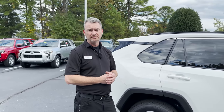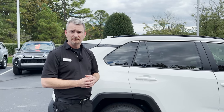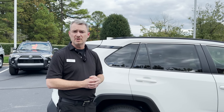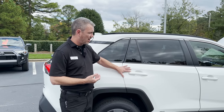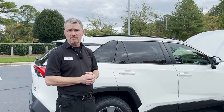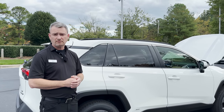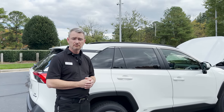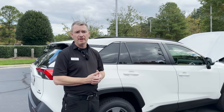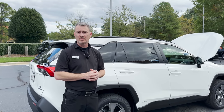At a service center that sees about 6,000 vehicles per month, how often might you replace a hybrid battery pack? We may see one a month, and that's usually a second-gen Prius — it's getting to be a more rare occurrence. Anything 2010 and up, we're not seeing the batteries. This particular RAV4 model line and the newer Camrys — we've not even seen them opened up except for recall repairs. We're not seeing battery packs come out of the new cars at all. As for a huge number — a Tundra hybrid battery pack for a 2023, if someone had to pay out of pocket due to an accident, I would expect that cost to be in the neighborhood of $7,300 to $7,500.